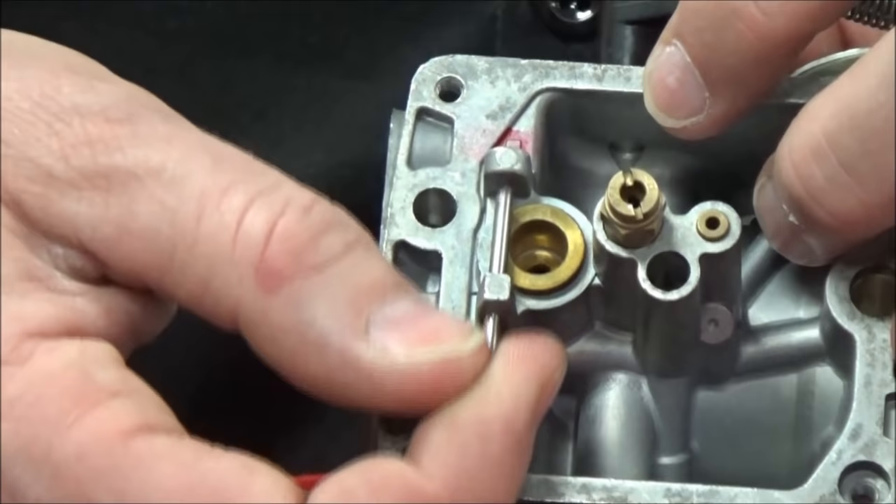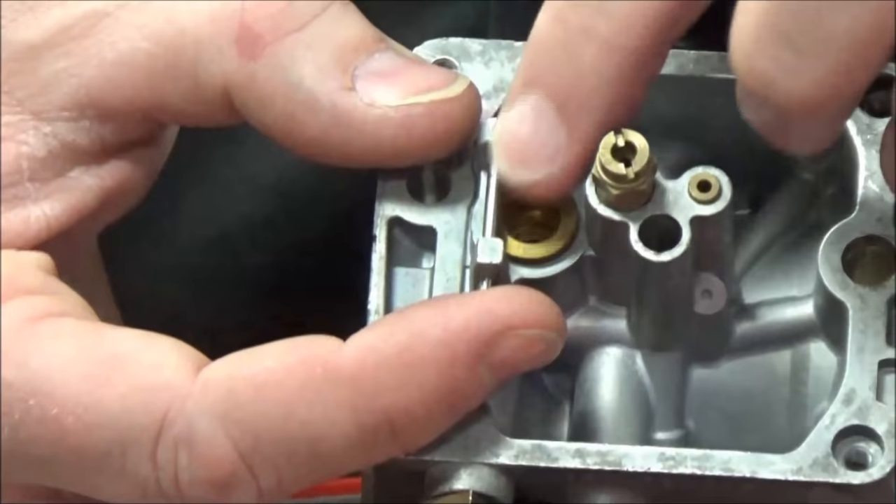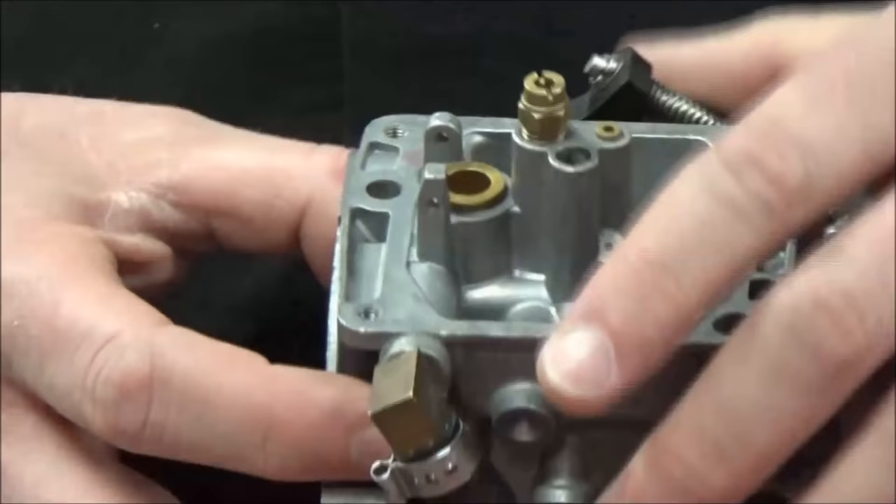Technicians who aren't aware of this or are in a hurry — if they try to punch the pin in or out from the wrong side, they're going to break the ear off. What I've gotten in the habit of doing after quite a few Harley carburetors is I just go ahead and do a little test fit. This allows me to see if the bosses themselves are worn out or egg-shaped — because if they are, it's never going to be able to shut the fuel off.